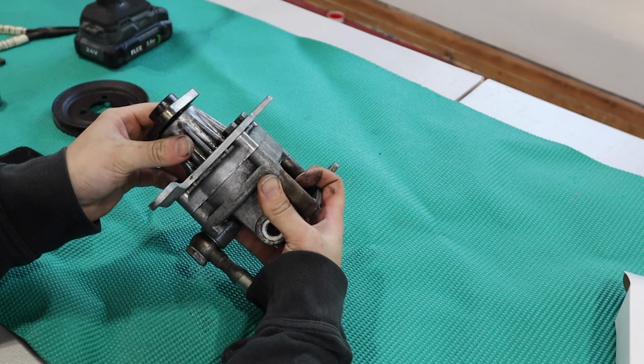So now that the steering fluid is pumped out, the first two lines that we're going to disconnect are these two hoses that come all the way down to the pump and lead up to the reservoir. It should be a 19 millimeter and a 22 millimeter. So let's get that off. There wasn't enough clearance to remove one of the bolts, so I just pulled off the hose.